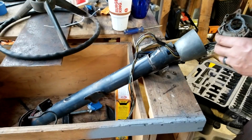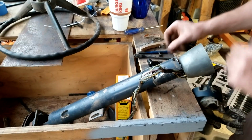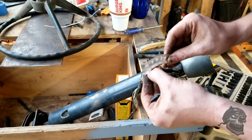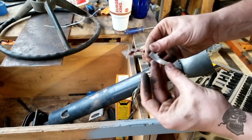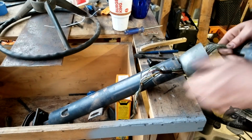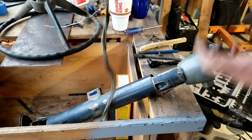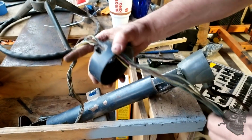Got these two bolts down in here. These two bolts pulled out. This whole mechanism was broken and this was glued on. Looks like a red RTV or something, so I'll have to replace that. And a little pointer that was also broken and the remnants are inside. Pulled this out, getting the wiring pulled out. So now I've got the turn signal module and then this upper collar.